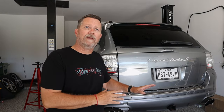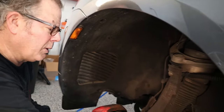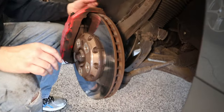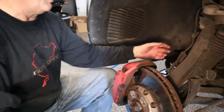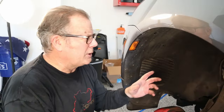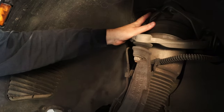If you watched our last video, you'll realize we're in the same clothes — and that's not just for continuity's sake. We actually just finished the rear lift; the car is still in the air from that process. So now Rob is going to explain what we're doing on the front end. We've got a bunch of stuff to take off to remove the strut. Main thing is taking the upper control arm bolt off, the lower strut bolt, and the sway bar end link.